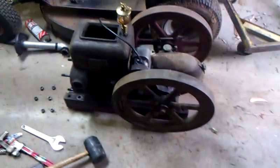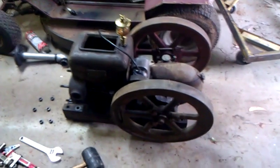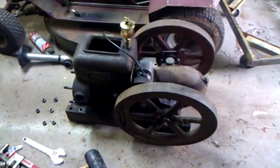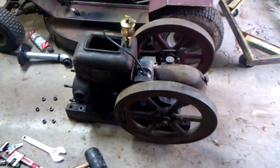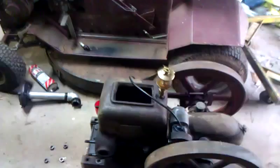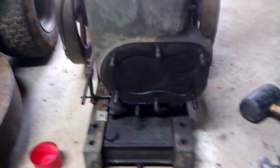My Sundial B engine, 2 horsepower, which I purchased from a person about 12 months ago. I've only ever really run it once — it didn't run very well, although it had compression and had been running previously. I tried to run it yesterday and the exhaust valve stuck, so I've taken the head off. You can see I've removed the head and there's quite a bit of carbon on the cylinder and the valves. The valves seem to be seating all right.